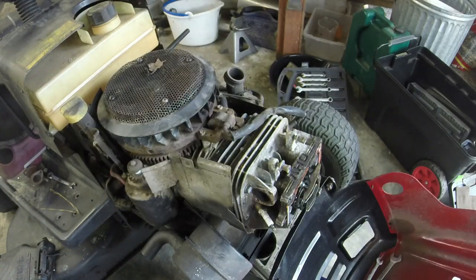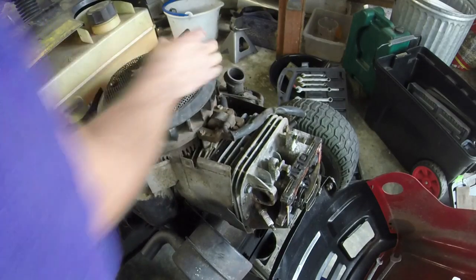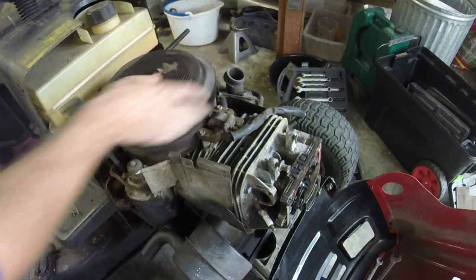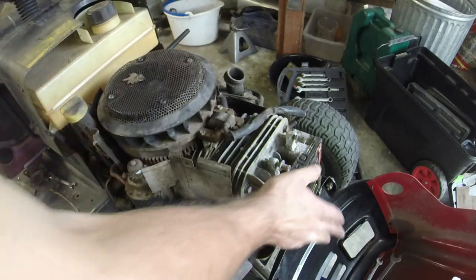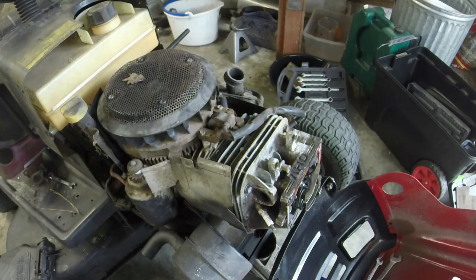So I think we're going to be going into this one to replace the camshaft, unfortunately. That really stinks. Because it's hardly moving at all, and it's supposed to move just as much as the intake valve. And so that would explain why it'd probably be running hot, because the exhaust temperatures are getting so hot because the exhaust gases can't get out of the engine due to a worn camshaft lobe.